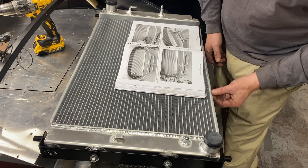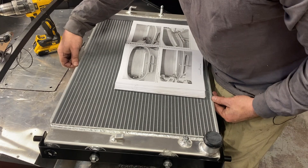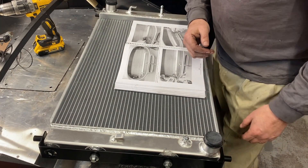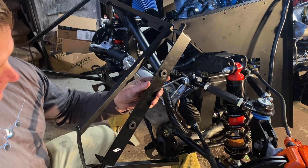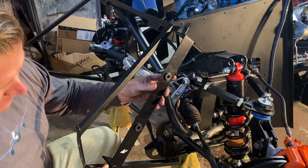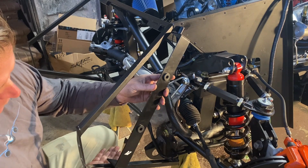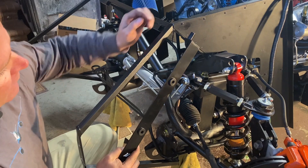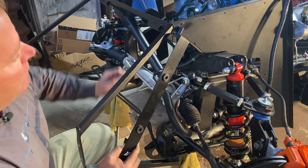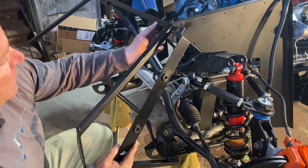There is very, very little room — we're talking about a quarter of an inch here. I'm pretty sure I can rivet into this for the bottom panel, but there's no way I'm going to hang the radiator off just that little bit of material. So we're going to modify this bracket — build another bracket for the top and modify the bottom so we can attach it. With the radiator in position, it's sitting about right here, lined up with the tube. I'm going to cut this knob off, build a bracket here, then straighten this one out and drill through them out here. I figure we can bolt through or rivet to both of these two members here and then bolt through or rivet directly to this — probably bolt, so if you ever take the radiator out it would be easier. I think it's going to be a stronger mount than what I'd be able to get on these little pieces of tube.